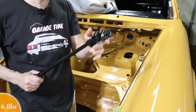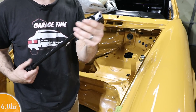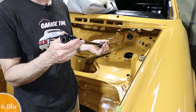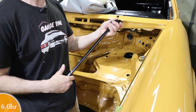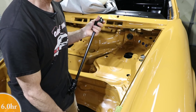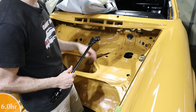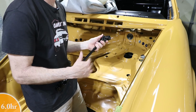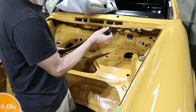This shaft here connects the steering column output to the steering rack, and it's been painted. The swivel joints are really nice — I didn't do much to restore this. It looks to me like it's completely symmetrical and doesn't matter which end goes where. There are splines on both ends — there are lots of splines in the whole system. Eventually the steering wheel needs to be lined up with the tires, but there's plenty of opportunity to do that with the steering wheel hub and the tie rod end. So I'm just going to install this wherever it fits and go on from there.